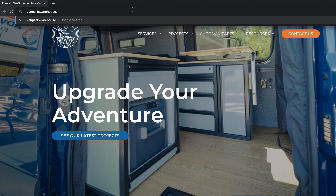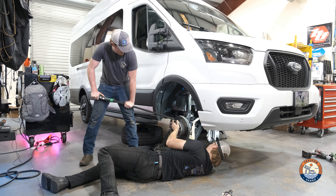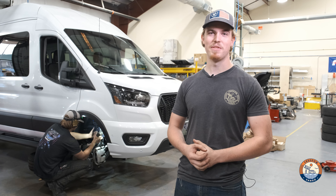The front end of the kit is pretty involved. The front end comes apart — the strut and knuckle assembly comes out of the van so we can remove the strut, replace the spring, everything goes back together, and the strut top spacers get bolted to the top. Everything else bolts in pretty simply.